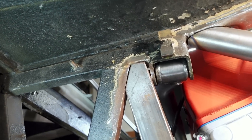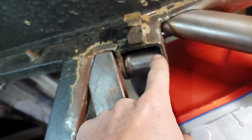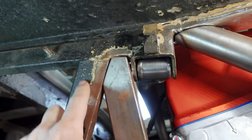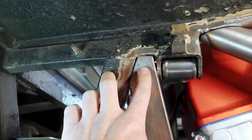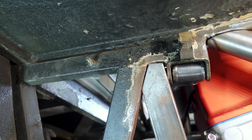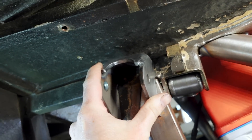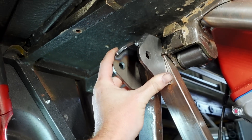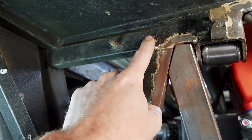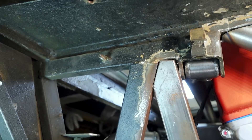Back in the fender well — this is the original shock mount, but we're not going to use it. Instead, we've got it set up as a cross brace in the engine bay. We're going to mount our new shock mount right here in this junction, which is a little bit better lined up for what we need and provides a bit more structure. We drew this mount in a previous episode, so now that we've got it made, it's just a matter of putting it into place — but first we need to get all of this paint ground off and do a little bit of welding.